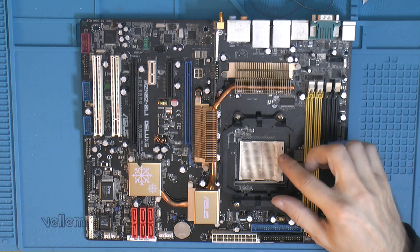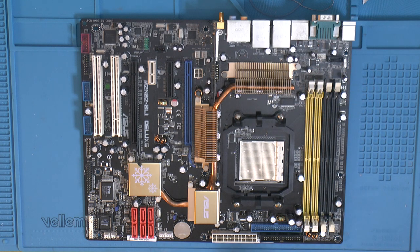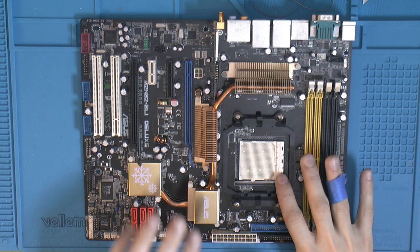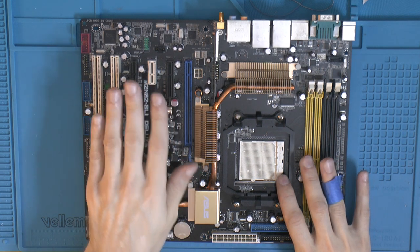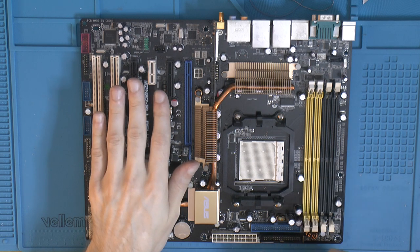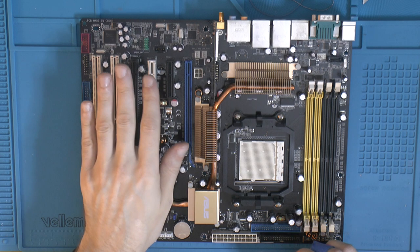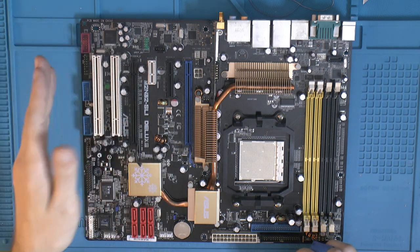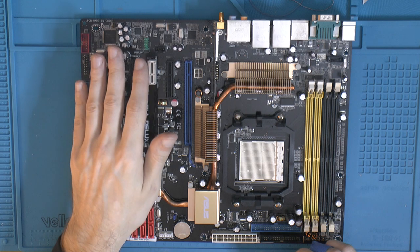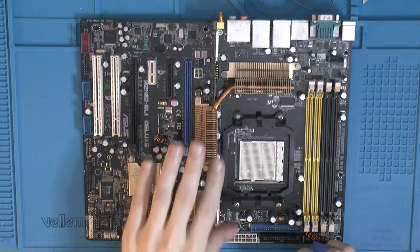Also, why I like to mount the cooler now is, like I said, I want to make sure it ends up in the perfect place. It's going to be tight with the riser, but from my measurements and the way the riser goes in now, because I have done the modification to the case, I should be able to mount the card in the vertical stand and put that in as one unit. So that should slide in under the cooler, but it's going to be tight.